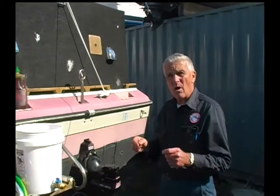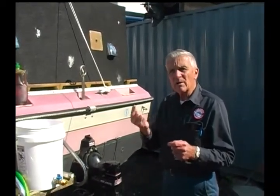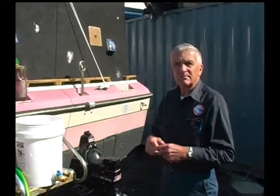Now sometimes water doesn't come out, so you've got to take a little small screwdriver or whatever to loosen up any rust particles, or nobody knows exactly what, but typically rust. That way the water would drain out. You also need to look and see if there are any other places that you need to drain water, such as in a heat exchanger or possibly a transmission cooler if it happens to have a drain. So every boat's a little bit different.